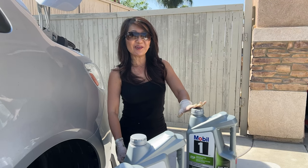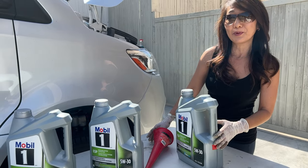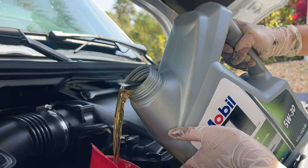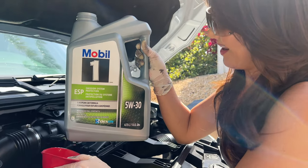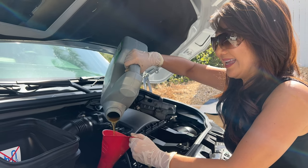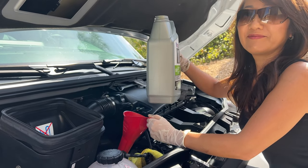It's time to put the new oil in. This van takes 13.2 quarts. We'll pour in two and a half quarts first — I just marked it right here so that if we over-pour we can adjust it with these two bottles. All the oil is in. We have to go inside the van to reset the service light, turn on the engine to check the oil level, and then put in more oil if it's not enough.